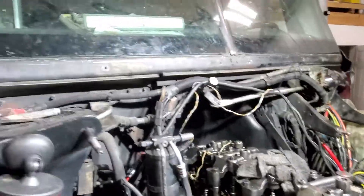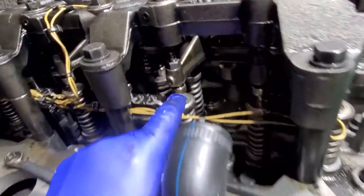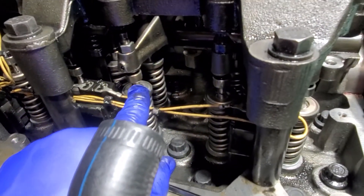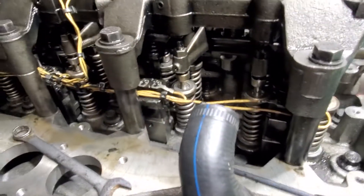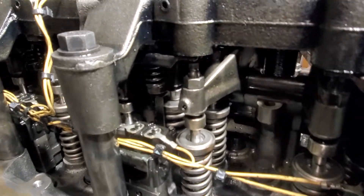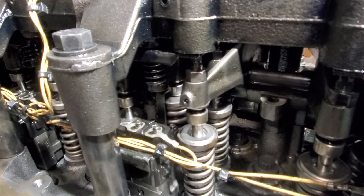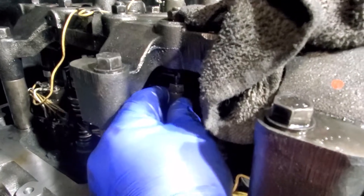I've got one and six done. Watch the exhaust and then the intake right here — you're going to see the exhaust when it stops moving up and the intake starts going down. That means your exhaust is in the closed position. This is how I'm rotating my motor. I've got a little movement on two and a little movement on five.